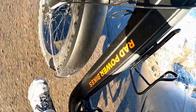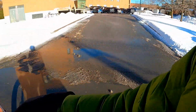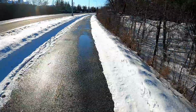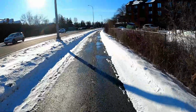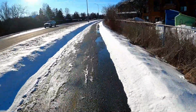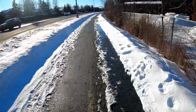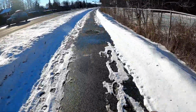Mixed with the snow and the moisture from the air, it creates a brine solution that splashes all over the bike and can seep into the bike's components. Of course, it can lead to rust formation on critical parts such as the drivetrain. Over time, this corrosion can cause mechanical components to wear out faster. In addition to its corrosive effects, road salt in Gatineau can also contain a mixture of sand, which is terribly abrasive when it gets into the chain, gears, bearings, and brakes.